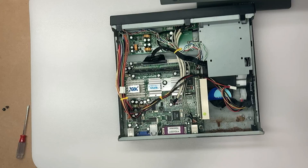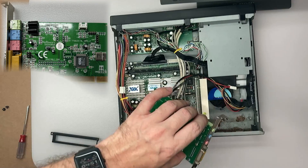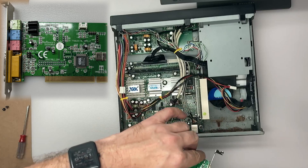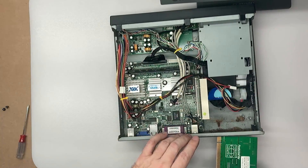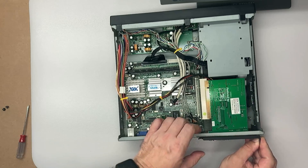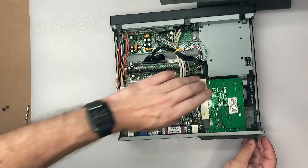This brings us to sound card choices. While we have an onboard VIA AC97 codec, it doesn't support DOS, nor does it work with something like the SB-EMU project. I've had a pretty good run with ESS Solo 1-based PCI sound cards and I reckon it's a good fit for this project. Getting it installed isn't the easiest thing — you need to remove the bracket and slide the card in through the slot, and it does limit the type of card you can install.